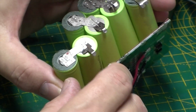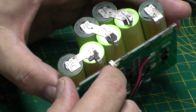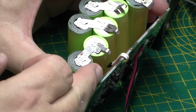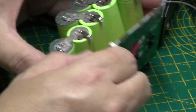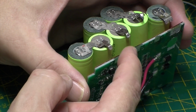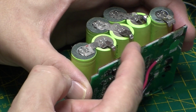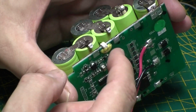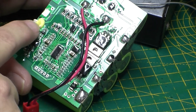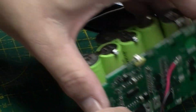And underneath is just like a little thermal fuse there, and some more of this double-sided sticky stuff. So we'll see if I can get the connections on this fuse as well, just to make sure that's not gone open circuit. It might just be a sensor rather than a fuse, because nothing is written on the board. If it is, it's been gunked over with some yellow stuff.